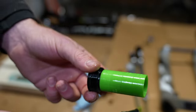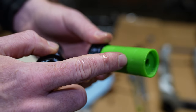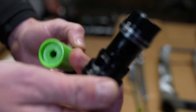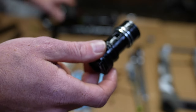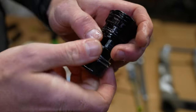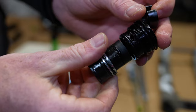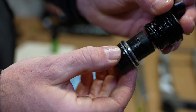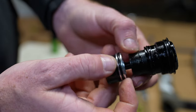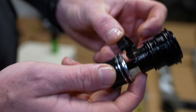Looking at bottomless tokens: I'm very pleased DVO copied RockShox — they take a cassette tool and screw on, which is an absolute no-brainer. The DVO Onyx takes up to four tokens, and the air spring is so good you may not even need them. The Suntour Duralux tokens are one of the biggest nightmares I've dealt with — three hard tokens clipped onto a rod, and I'm not even sure what the lower piece is because there's no instruction manual. DVO is way more thoughtful, has good instructions, and is very simple; the Suntour kind of reminds me of ordering from AliExpress — it works pretty well but you have to figure it out yourself.